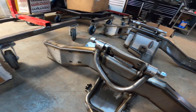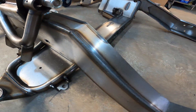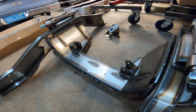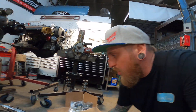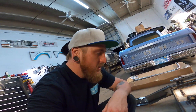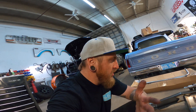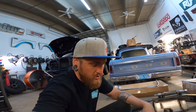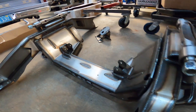Really nice 3/16th plate, all laser cut, and robot MIG welds — it's Hutch's Welding approved. That's your cross member. This is pretty much designed to be all bolted — as you can see, these slide over the frame rails and get bolted in. I'm probably going to weld some stuff in and modify a few things, but for the average guy you could essentially bolt this in. That's one of the beauties of the drop member for the C-10s — it's a bolt-in ordeal.